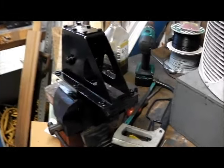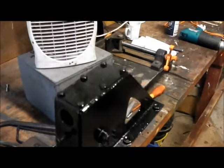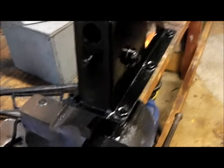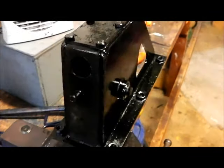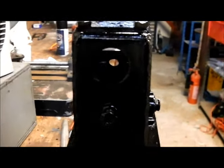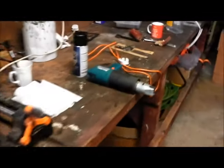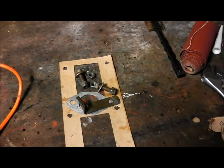Here's the modified pedal tower - pedal box. As you can see I've re-tapped all the threads M6 for some little bolts, so all the holes are filled now, it looks a bit better and no stripped threads anymore. I've just degreased and given it a quick spray of paint which half an hour or so will bake hard. I've also bored a hole there for a socket to go through so you can access the adjusting nut - that should make it a little bit easier in the future. I've also made a new gasket for it and just cleaned up the various bits and pieces to put it back together.